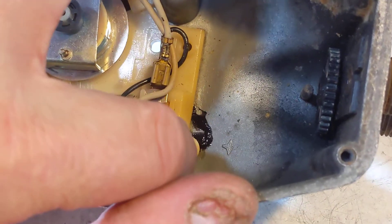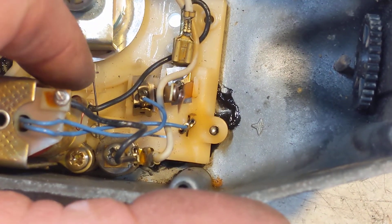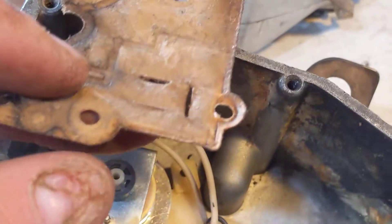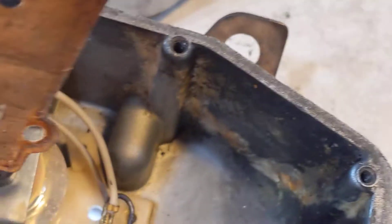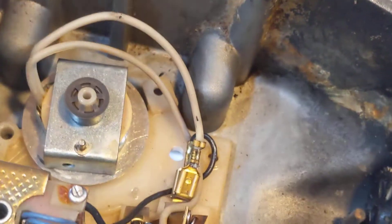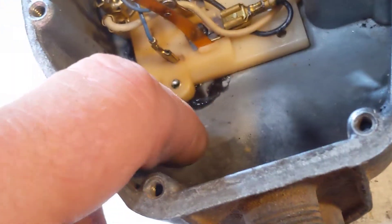A repair I had to do: the base of this is basically open — like half-open tunnels or pathways where the vacuum goes from one point to another. Unfortunately they leak badly because the original seal was just a piece of paper and the pressure of the white plastic on the bottom. But look at this — it's completely corroded. It cannot possibly hold vacuum. So what I did is I pulled out all the paper — first experimental — then I tried different adhesives to try and make a gasket. This one seems to work really well. I've got three of them so far, and all three hold the vacuum perfectly. I think these are all going to be very good working units.